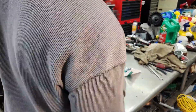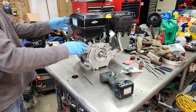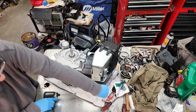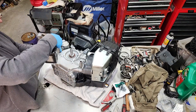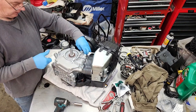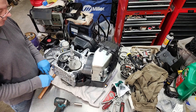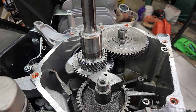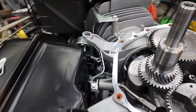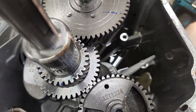All we have to do is crack this thing open and swap all the internals. First thing I did was take the cover off around the fuel tank so I could get at the front recoil cover and the rear sump cover. I'm going to lay this thing down to get at the cover and pull off the sump cover and oil fill stick - very carefully, because I don't want the gears to pop out inside. There's a balance shaft and camshaft in there, so I want to take it off carefully so I don't miss the timing marks. I was able to save the gasket which is $30, and I can see the timing marks. There are two dots for the balance shaft and I did see the timing marks on the camshaft and the top gear.